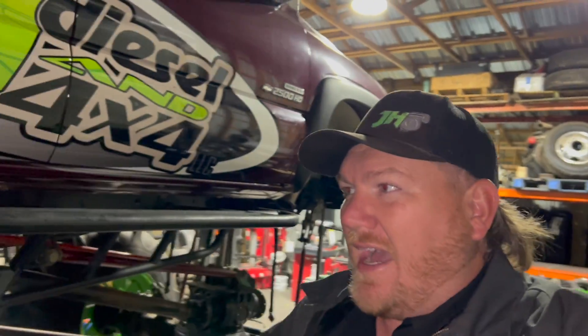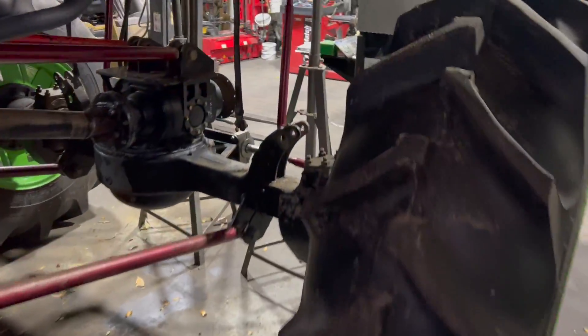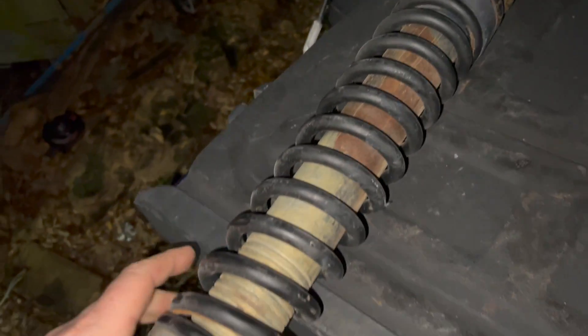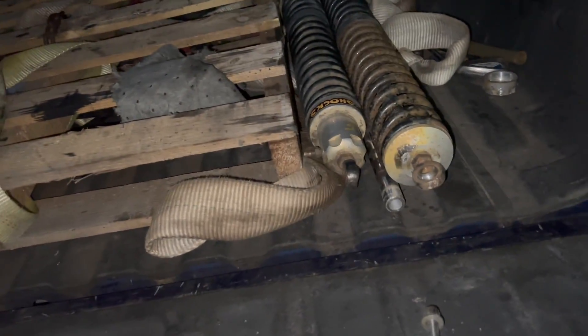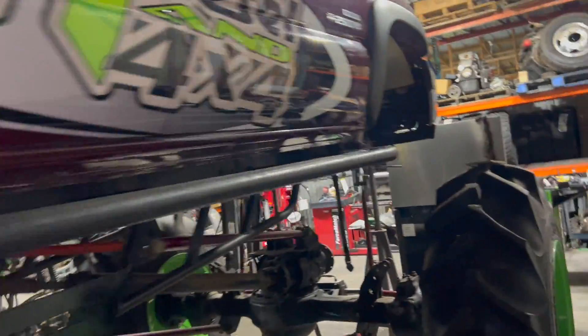I got a list of things we're doing to the truck. As you guys know, we have no shocks — nothing. But good news, we got shocks right here. I took it to my buddy and had him go through them. We bent the shaft on one — here is our bent shaft from the shock, pretty impressive. We still got our bent link bar too. We got our shafts all replaced in all four shocks. Some of them were rusty and just old — they've been on there a long time. He also revalved them for us, so hopefully the truck's a little smoother. It was a little stiff before — my Ford was way smoother than this thing.